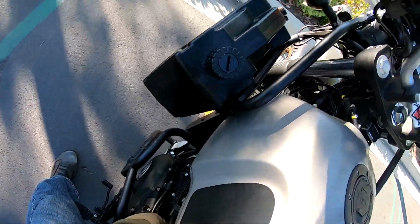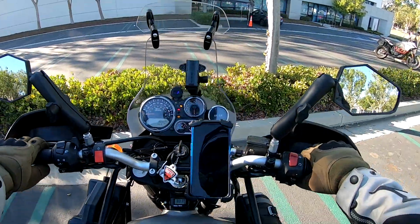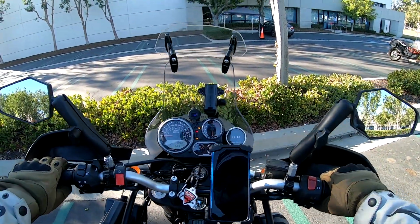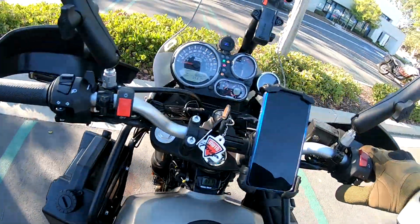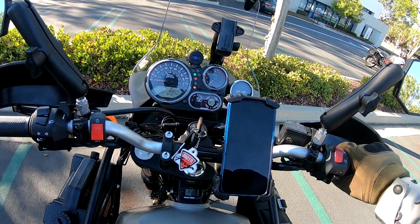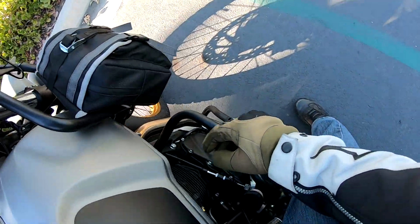And nothing happened. Looks like I'm still in gear. But oh no, we didn't have a fuel prime there. Oh, well, that's because we don't have a fuel pump anymore. The choke has two positions. It's all the way out right now. Full choke gives me about 2,000 RPM.